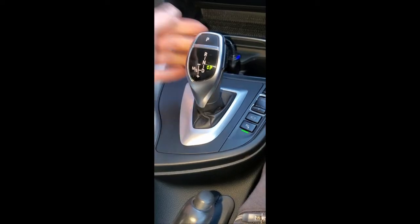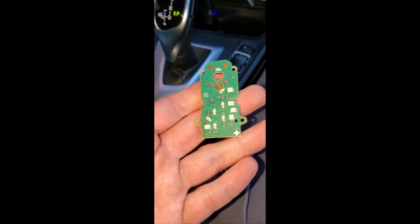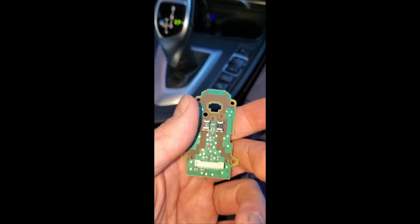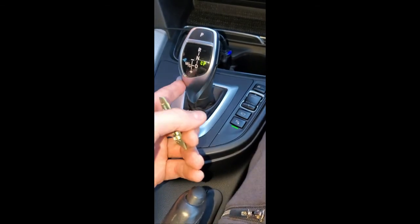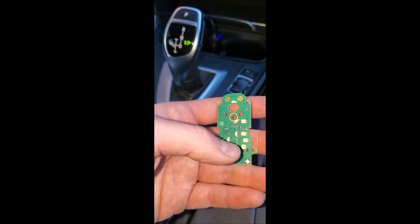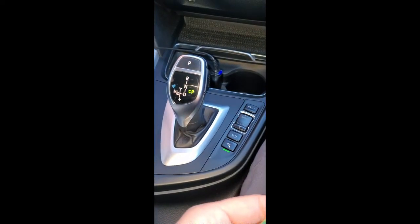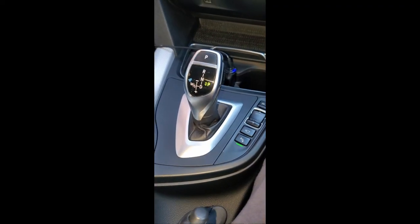So that's all it was — it was that circuit board which I've taken out. It must have been something to do with this bottom LED. It's annoying that BMW want 852 pounds for a whole new gear stick when that is the problem — something to do with this circuit board. I'm not an electrician, but that's just ridiculous. There's a little connector there which you can just — I believe that's what they want for that. So that's how you fix that. Oh, thank god for that.